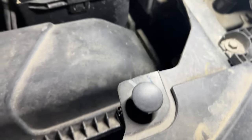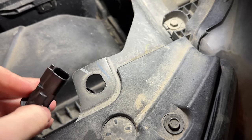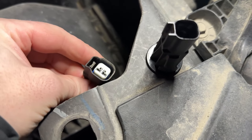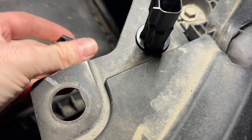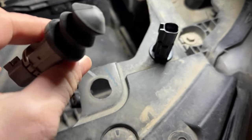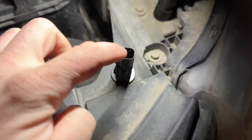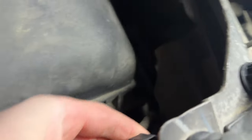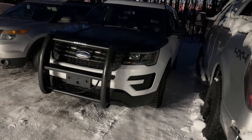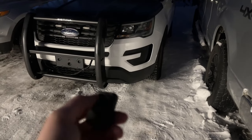Here's where the hood switch goes — I show this in my video for the other Interceptor. This is a little dummy holder that the harness, if equipped, will plug into. All this is is a little interruption switch that only goes here. I went ahead and added it — I'll put the part number in the description. All you do is pop it right in where this thing went, plug it in, and now your hood switch is enabled mechanically.